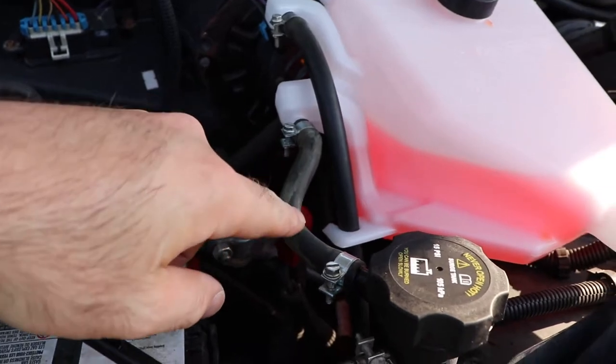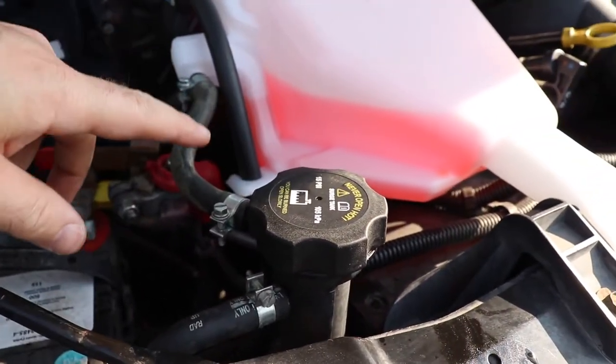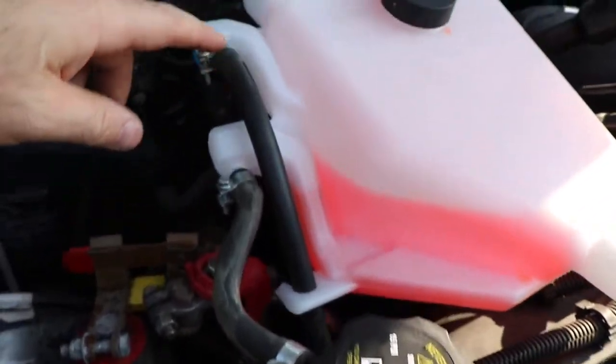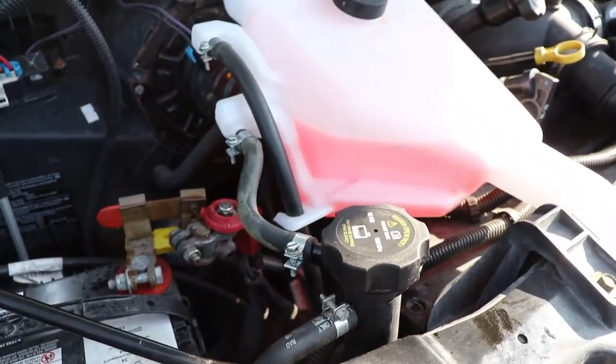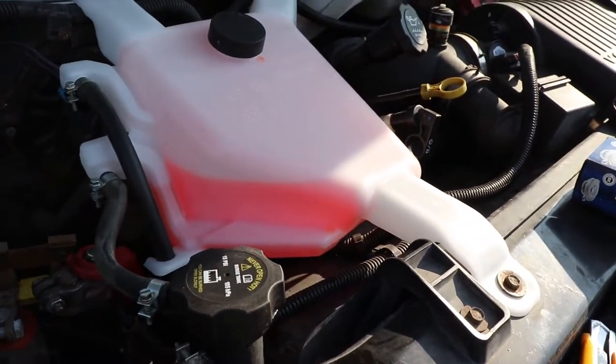You want to have this hose as short as reasonable so you don't put a kink in it, because that'll affect refilling the tank and radiator back and forth. This hose now has a clip and it hangs down past the lower radiator hose, and it hangs in a good spot so it doesn't give you a false indication as to what's going on. It's a pretty simple job — thanks for watching.